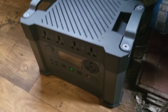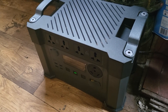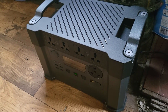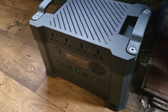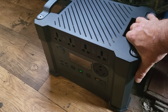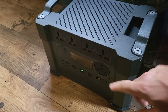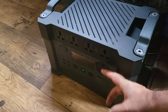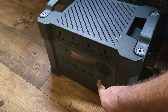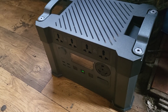The biggest issue with this is this socket here — it's chucking out 240 volts at 30 amps, which is very good. But the problem is it's an American RV plug socket. You can buy these and they cost about 50 pounds for the socket, but don't get the long one, because if you get the long one it covers up the solar panel port, so you can't plug the solar panels in when the mains is plugged in. That's a real bad design.